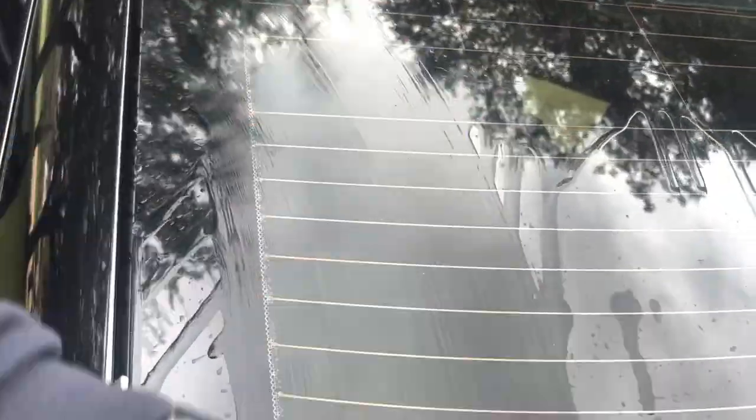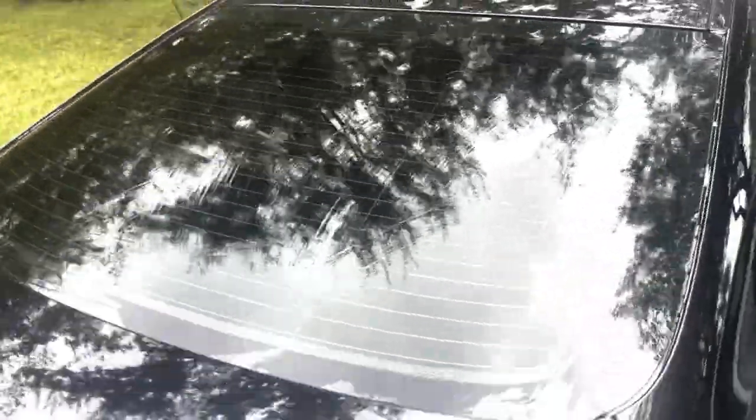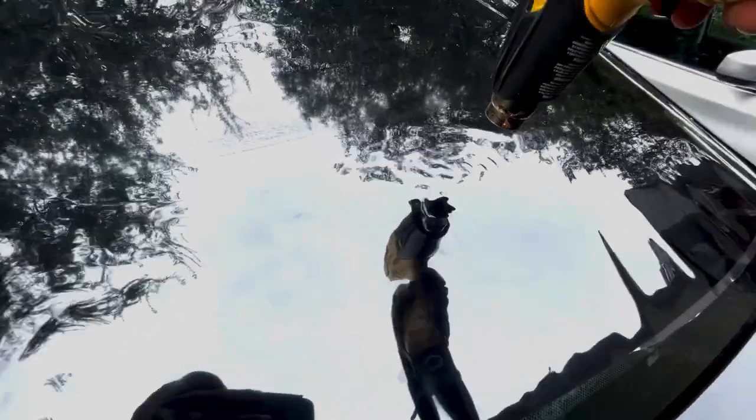Go ahead and just apply it — you can attach a sprayer to the bottle. Once it's on the glass, just go ahead and use your hand to wipe it through the whole glass. It is colder now, so this is actually perfect. The alcohol will make it dry a lot quicker than if you were to just use a dryer sheet with water, so make sure the full glass is covered with no dry spots to avoid the film tacking prematurely.